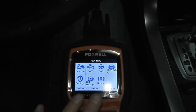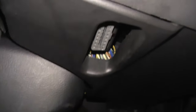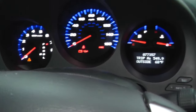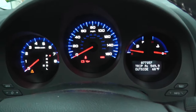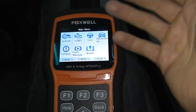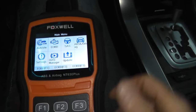If you're not familiar with these scan tools, they all have the same hookup. Every vehicle from 1996 and newer — it's a federal guideline — they all have the same inputs. So you just plug it into the vehicle. As you can see, the car is not running, but I have the ignition key in the on position — that's Roman numeral two on the ignition system right here. Just have the system on, and now we're going to scan the system. This does not use an external battery source; it runs off the vehicle's battery. You just plug it in and it turns on.